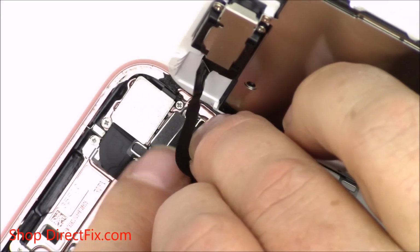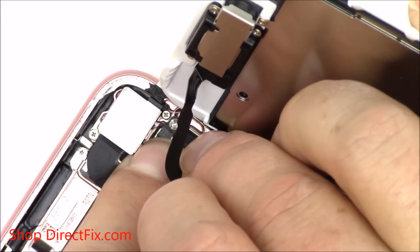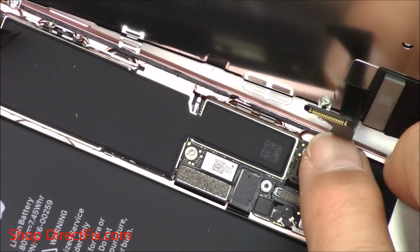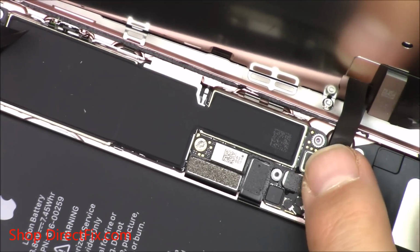With all the new parts on the screen, you're now going to start by reconnecting the top screen connector, or pushing it down into the socket connector. Now you're going to push down the 2 other connectors to reconnect the screen. The lower one goes first, then the upper one over the top.